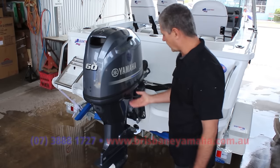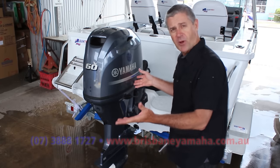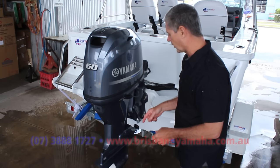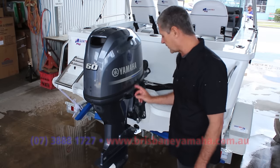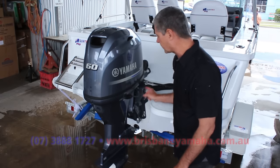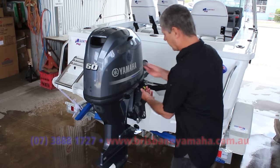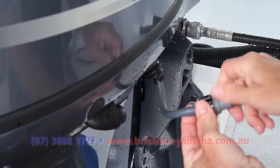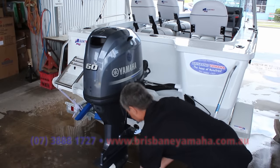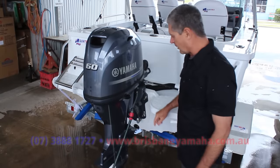The other way to flush your motor is the cold flush — in this case we don't start the motor. It's ideal for apartment blocks or late at night when you don't get the chance to start it up. Starting it up is the best way because the flow goes all the way through. The reason we don't start it with the cold flush is that the impeller spinning down there pushes the water up one way; putting it this way reverses the flow, so we don't want the two to fight each other. Take that off — it's just your hose fitting, you'll need an imperial or American thread to fit into that — snap it on, and you can see it's already going through the system.